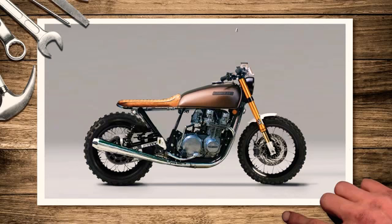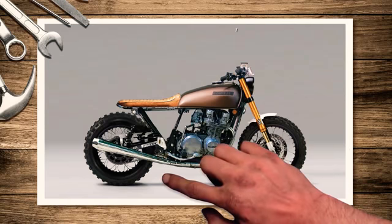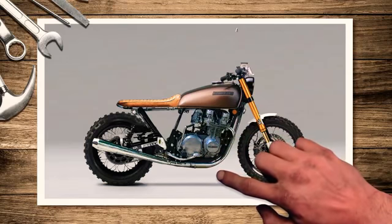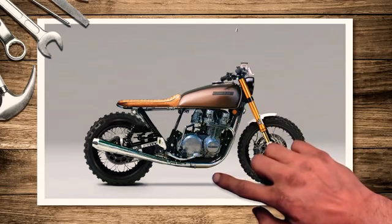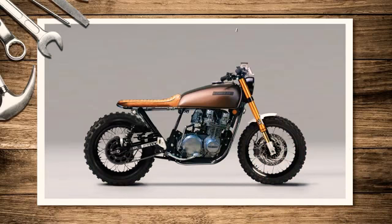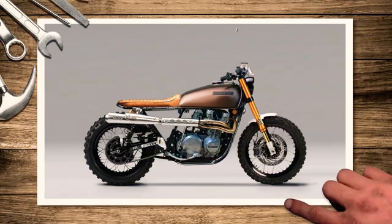Now this exhaust at the bottom - I really don't like it. From a practicality and visual point of view, the muffler at the back is far too big. From a practicality standpoint, if you're going to go off-roading or scrambling, you want your exhaust to be high up. If your exhaust goes down at the bottom in that street bike or cafe racer style, what's going to happen is if you go over rocks and bash the bottom of your frame, chances are your exhaust is going to be bashed in as well. So let's take that off and move it to this really nice exhaust that goes around the top of the engine. Make sure that heat shield is there, because if you're putting your legs next to that, it's going to burn - heat shield is a definite must.